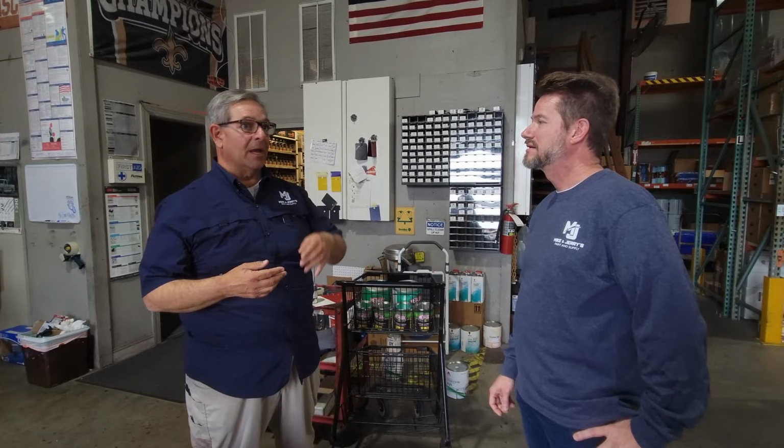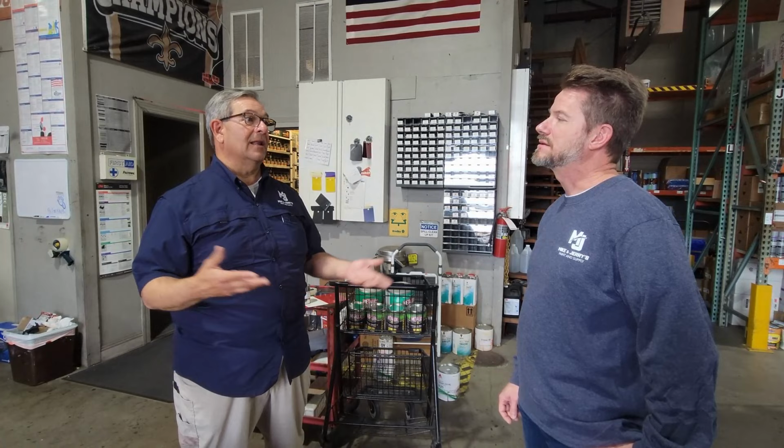So we're going to aim for 2 coats of this, and I'm used to shooting like 3, but 2 coats is good. Most of your experience in the past has been with base coat, and base coat is not designed to cover in 1 or 2 coats. Base coat has no UV protection. It's just color, and it's made mostly for metallic colors. If you covered metallic in one wet coat, you wouldn't see any of the metallic. So most base coats are 2 to 3 coats so that you can have the effect coming off of it, and the clear coat enhances that effect.